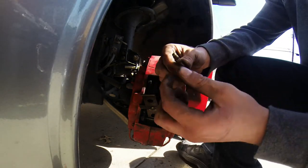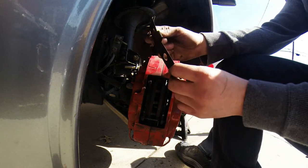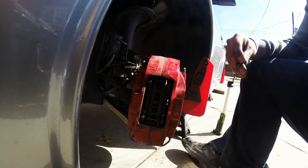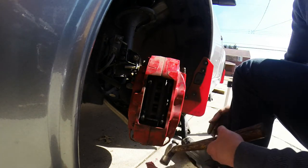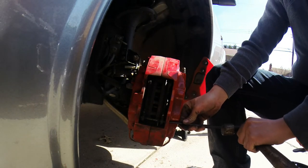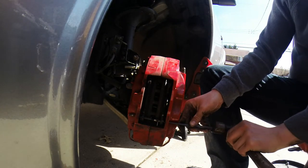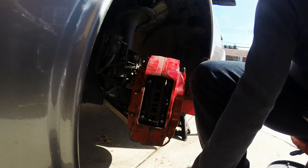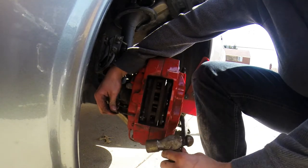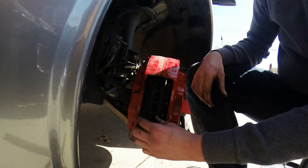Which we're going to clean up. This ball is what is expanded and I'll squeeze down when it goes in there. That spring goes U-shaped, so it loops underneath and it's going to bend down and give you that tension there. Set that all aside. Start tapping out the other bottom one. I just went from a bigger one to a little one to go farther in the hole there. Now this one without the spring tension is pretty easy to get through. Alright, there's that. Now this is all going to be squeezed in there.